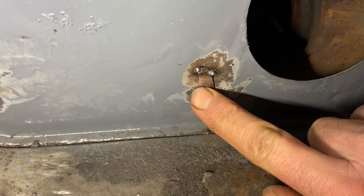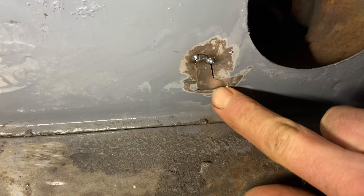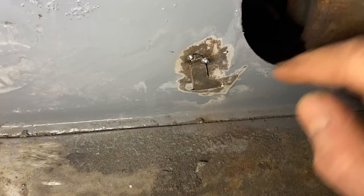Got the magnet there, and it now fits after a lot of sanding back with a croc sander. We've got it into that shape. Okay, I put a couple of tacks on, and I was about to tap it with a hammer, but I just pressed it in and it just clicked into place, so that's nice and flush there. It's actually gone in a bit there, so what I'll do now, I'll put a tack here and I'll go around the other side and knock this bit back out again.